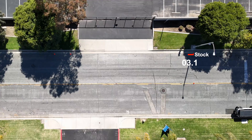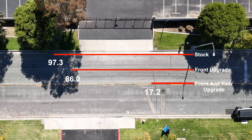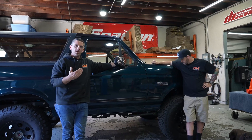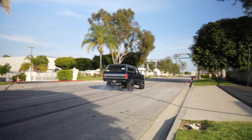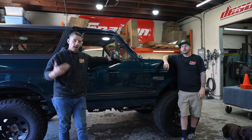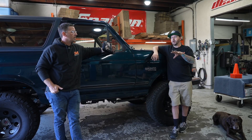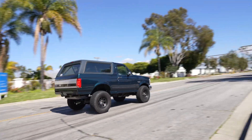A 60% increase is pretty big — going from 97 feet to 36 feet, from 40-45 mph to dead stopped in 36 feet. Front brake only was a little under what we expected with about a 10% increase. We attribute that to the short wheelbase and long travel suspension — the front brakes were biting so hard the nose was diving aggressively, making the rear tires super light. But once we paired the rear brake setup with the rear end, you don't get such aggressive dive from the front — it stops much flatter, braking evenly across front and rear.